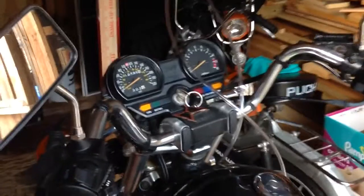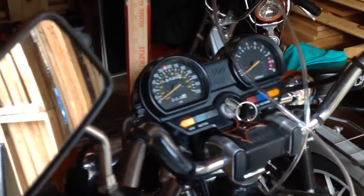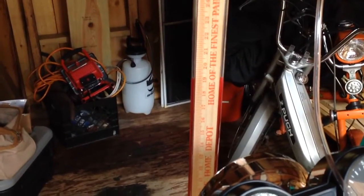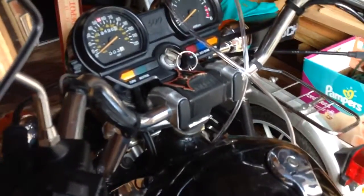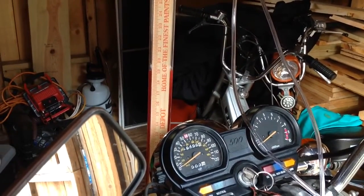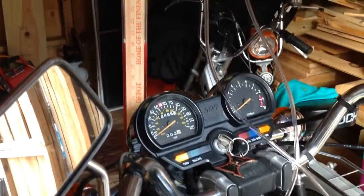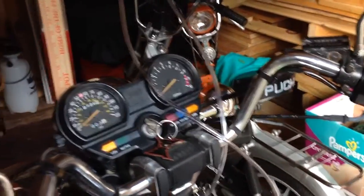So what I've come to understand is that what I want to do is turn it on, let it warm up and idle, and then watch these. They're going to bounce around, but I want them to basically be level-ish. But the problem I'm having, which I could really use some input on, is that I can get them to go one way or the other, giving more to the front or the rear carb. I can't seem to get them to sync equally. A hair in either direction makes them get offset.